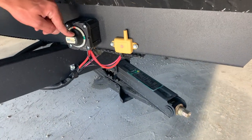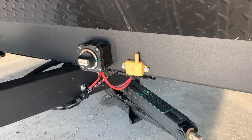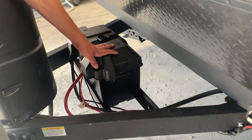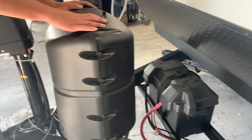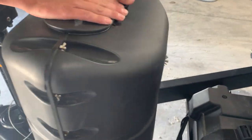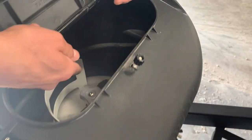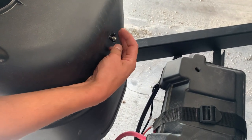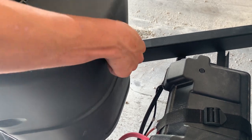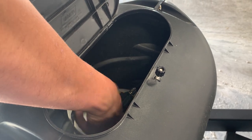Around the front of the unit you've got your battery disconnect. With it in the current position — which is on — the batteries are connected to the unit. Return it to off and the batteries become disconnected. The battery is located inside this front box; take the strap off and the cap comes right off. Then you get to your propane — just loosen this tab up top and flip it back to access the 20-pound propane tank. To change the tank it's as simple as taking the wing nut off, the cover comes off the bolt, and you can pull it right out. Turn the valve counterclockwise and that opens up the flow of propane to the unit.